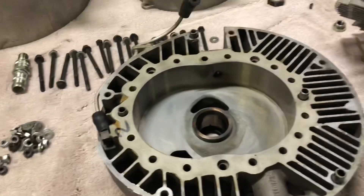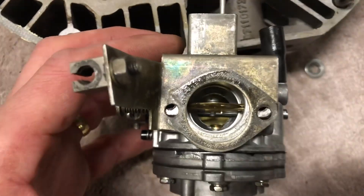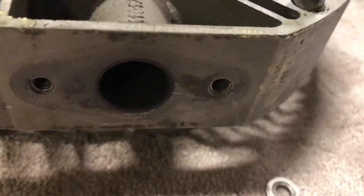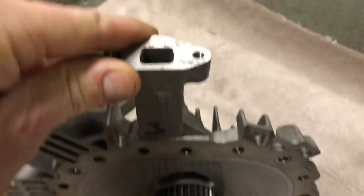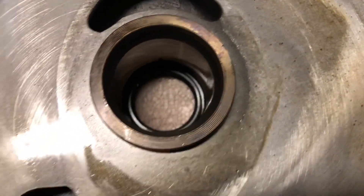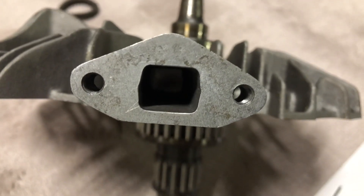After some measurements: the carb here has a venturi of 15mm diameter. The inlet port is a small 15mm across by 13mm high, so that's obviously the restricting factor. The exhaust port all the way through to the rotor housing is 18mm, so I don't think there's any restriction with the exhaust. I just need to open that inlet runner up a bit. The mixture comes out through there, cools the bearings into the case, and then comes out through the inlet port — so I'll just give that a little bit of an enlarge and polish and pop it back together.